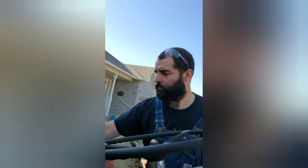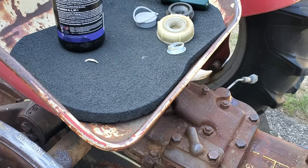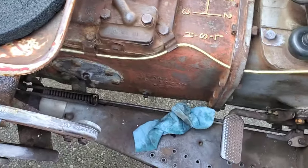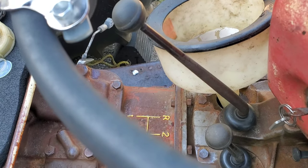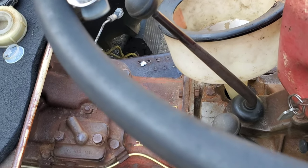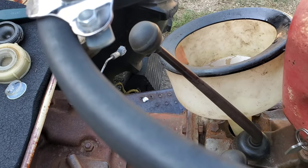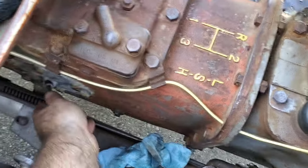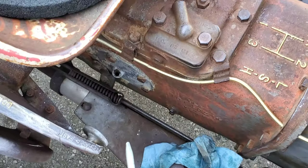That's 10. So 30 quarts is how many liters? Putting oil in. Supposed to be 30 US quarts, to liters is about 28 and three quarters, so say 29 liters. And we're at that now, and we're almost showing full on the dipstick.